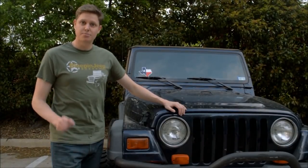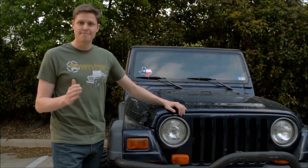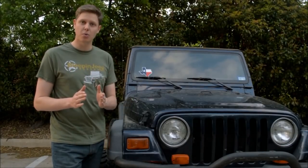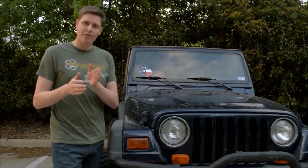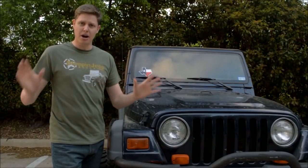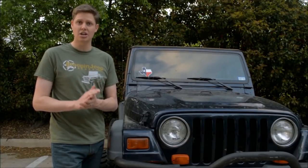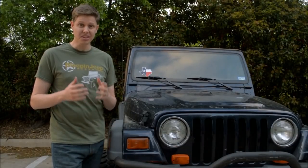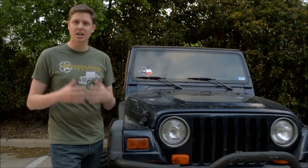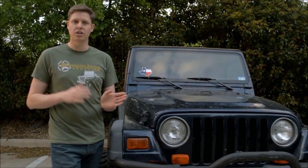So let me tell you how you actually get this done. It's pretty simple because the engineers built in a system for this. However, it's not going to be as simple for me to explain because many year models of the TJ do it differently. I'm going to show you how it works on a 97 and talk you through how it works on 98s through 2002. After 2002 it seems to vary a lot depending on year and whether or not you have a Rubicon. So for everybody, I'm going to encourage you to look in your owner's manual — there will be a page on how to disengage the clutch interlock or the clutch safety switch, because it's made to do this. This isn't hot-wiring anything; I'm not doing any workarounds. This is exactly how it's intended to function.